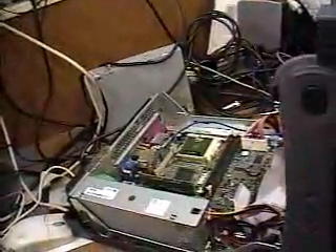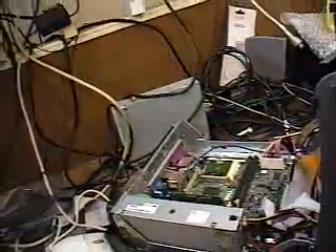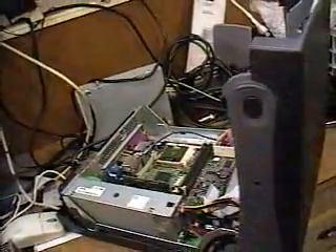So you have to be aware of what's going on inside the computer. Even if you don't fully understand everything, just listen to make sure there's some noise coming out of the case when you have the lights illuminated on the tower. That noise is usually fans running inside the case. So if it's running quieter than usual, you have a suspicion that something went wrong inside, and you should have it checked out.